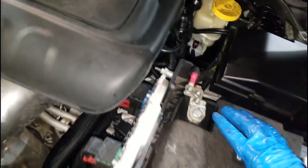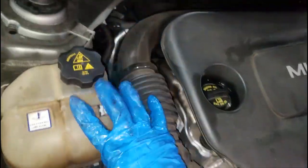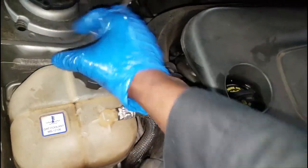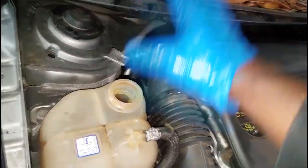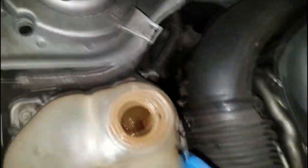Thanks for staying with me. When doing a visual inspection you really want to look around — you might even have to raise the car in the air. I mentioned pressure testing, but this reservoir here requires a special adapter to pressurize the system; it's not your typical radiator cap pressure setup. As you can see, it is low on coolant.